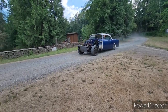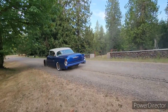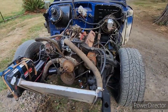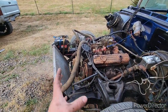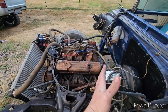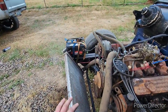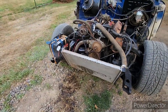Water's spraying out — she's a little hot just from that little drive. I've had the front clip on this before with the engine in place and it was real tight up here. This motor does seem like it sits really far forward, but this is where it originally sits in the 73 chassis. I think I'm going to run electric fans. This radiator is just an old one I had laying around and it's cooked anyway — it's got holes in it.